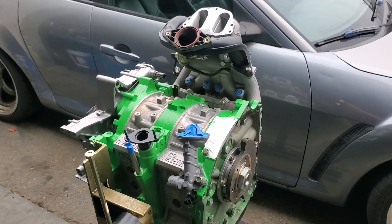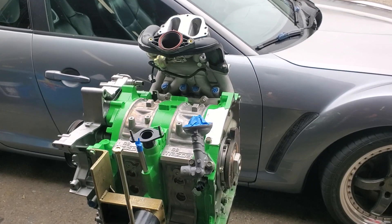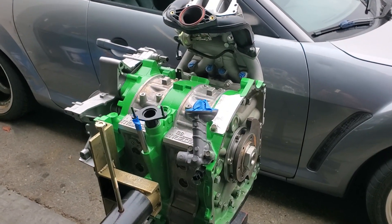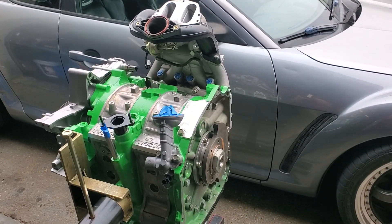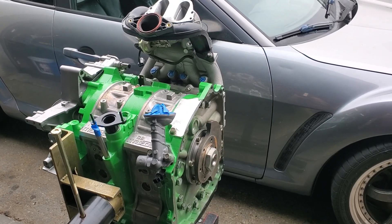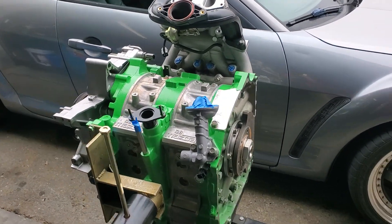This is our general process when it comes to racing Renesis motors. They do suffer internal heat issues, so always keep your Renesis motor oil temperatures below 230 degrees and water temperatures below 230 degrees. I really recommend keeping it closer to 220 so you don't ever run into a situation where you go slightly over those fail points.